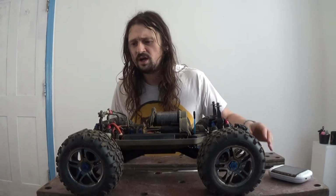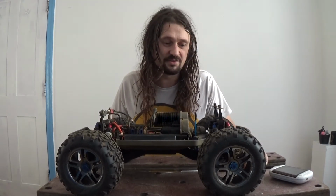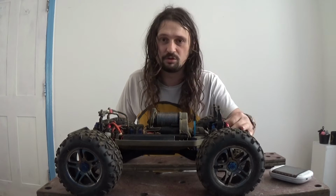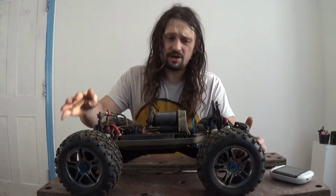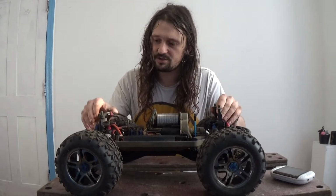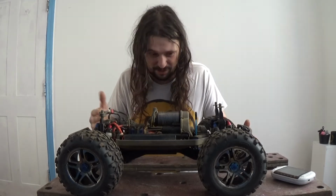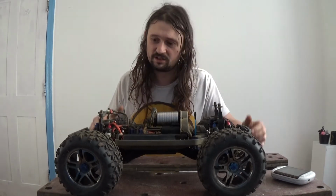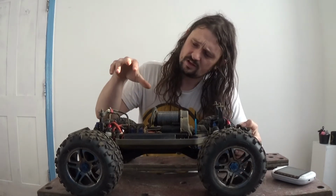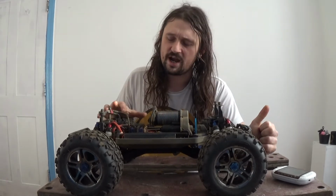They tend to flex a lot more than Traxxas out-of-the-box parts do. So, rather than snap, it just flexes when it hits something. And they really are durable. So, change the suspension towers immediately. I'd say RPM suspension towers have worked for me. I've only actually changed the back at the moment because the front doesn't seem to break, but apparently it will. So suspension towers. Change the drive line you can change.